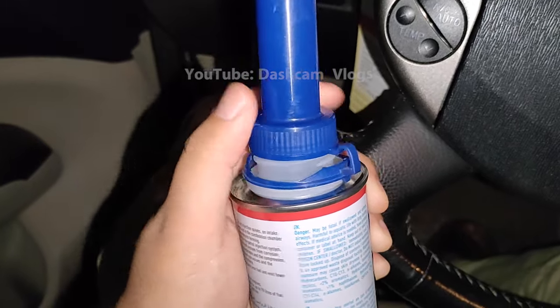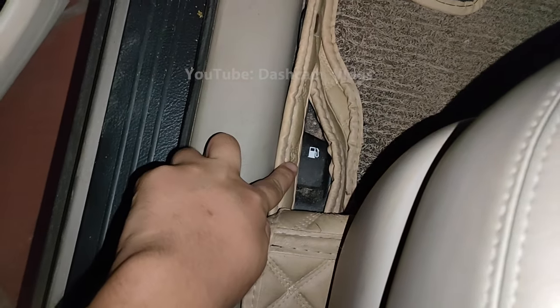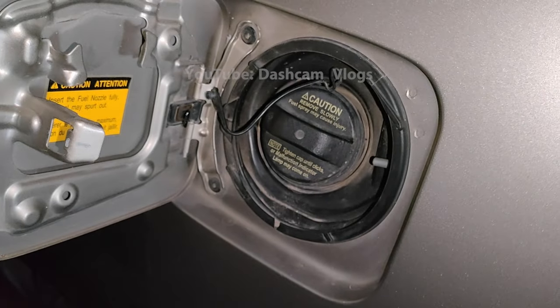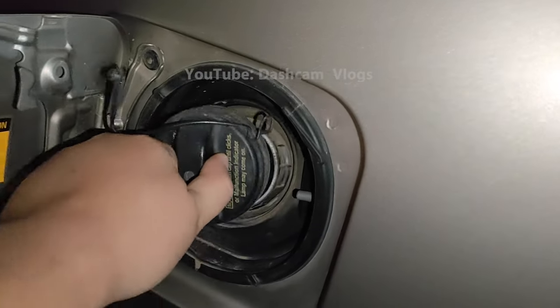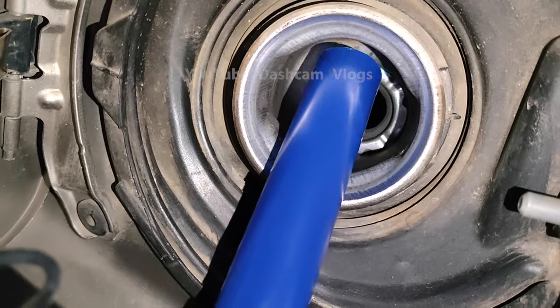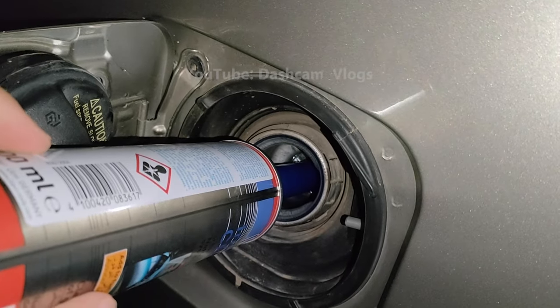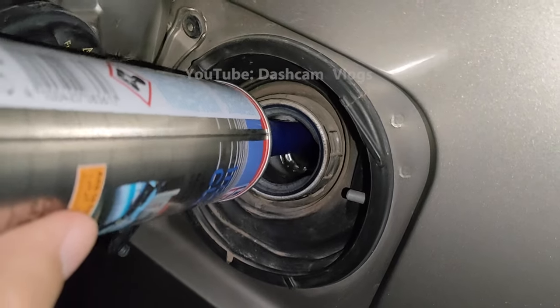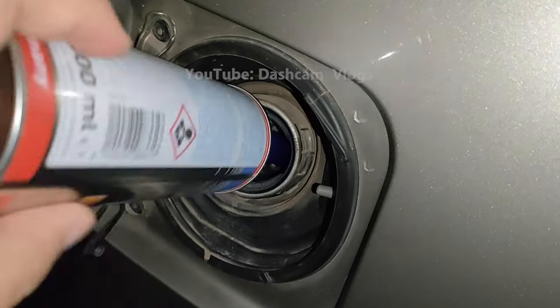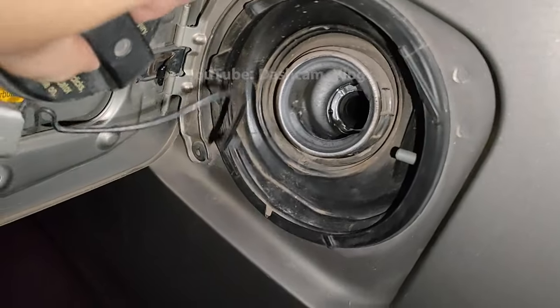Then apply the straw. Press the gas cap button to open the gas cap. Twist the cap to open. Put the Liqui-Moly injection cleaner into the hole. Make sure the bottle is empty. Close the gas cap.